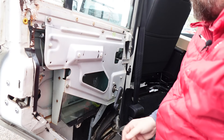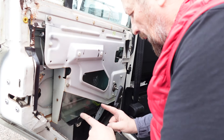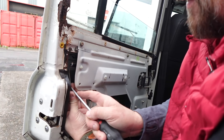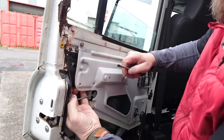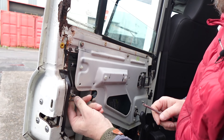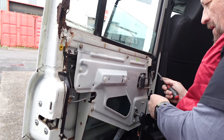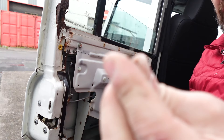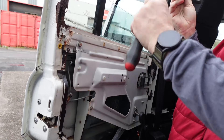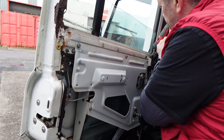We've just released our bracket. The reason I've done that is because we're going to be lowering the window all the way down through the face of the door. Just pop this pin off and that bar will now come out. The clip's actually going to stay on because it's inside a plastic clip holder, which is great — so this is now free. We've got to do the same over here. We'll remove the push-button lock.